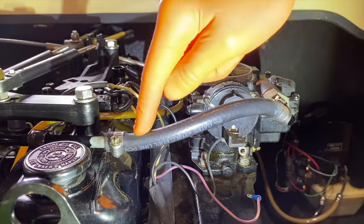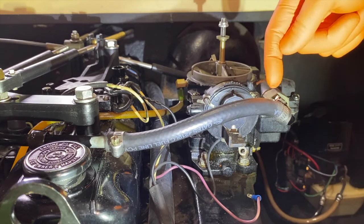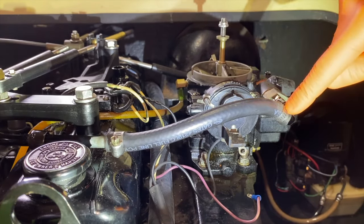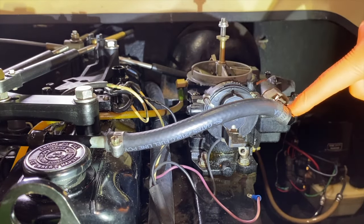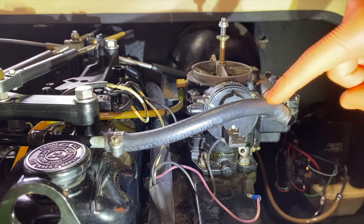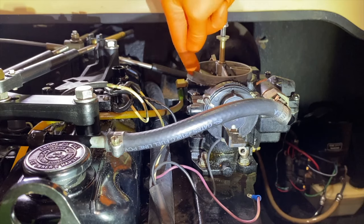And a quick reposition of the camera, and again, this is the fuel hose or line that I was just referencing. We are going to loosen up this flathead screw and worm gear clamp and shift it up onto the hose and off of the actual hard fitting here. However, before I do that, I'm going to come to the back elbow fitting here, feeding off the starboard side of the carburetor barrel or inlet.